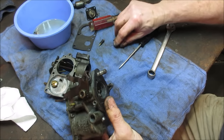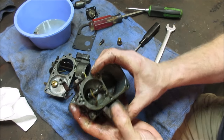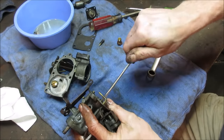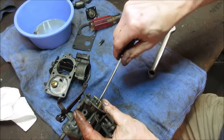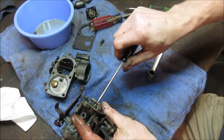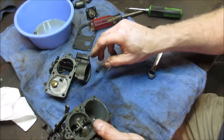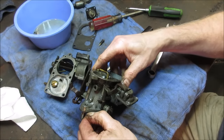So we're gonna take this whole thing, throw it in an ultrasonic cleaner, and let it get whooshed. We got one more up here. And we'll put it back together. See if I've got a carb kit for it, like I said. And I think we can probably purge. We'll look in that gas tank and hopefully purge the fuel that's in there out of there. We'll go soak that, see if the base gasket will come off.